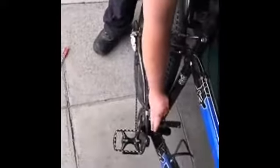Yep. So, I would say if it was just a small rise, a small hill, then I might keep it in the top gear at the front and just come down. If it was a steeper hill, then I would be more likely to bring that other cog down, because you would need easier pedaling. If you're going to keep it straight in the smaller cog here, you'd need to be pedaling up Mount Everest to use that gear most of the time.